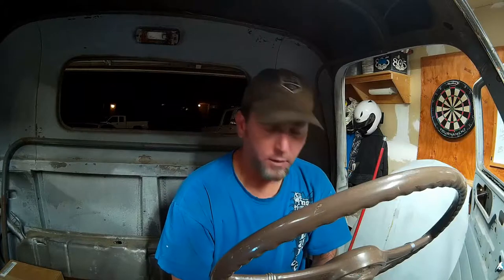I've resolved all that, and I've got power to my turn signal switch, I've got power to my turn signal indicators, I've got power to my headlight circuit — I checked that at the chassis harness. And what I'm doing right now is pulling the codes out of the ECM because I am getting my check engine light flashing as it should be. I connected the data link connector wire for the diagnostic test port, which is the white and black wire on pin A14 of the ECM.